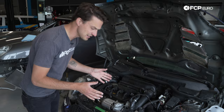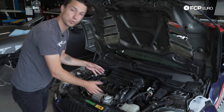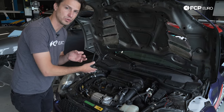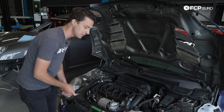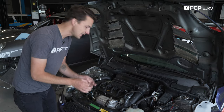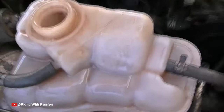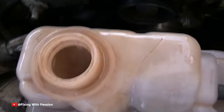As the car came back to the pits, the first line of defense was to put some coolant or water into the car to try to cool the engine down. You want to be careful about doing that because you can crack the block if you add water too quickly, but most modern cooling systems aren't going to cool water from the reservoir that quickly. One thing noted when that happened was the water seemed to be under pressure — a little bit of pulsing. That's an indicator that the combustion chamber has been connected to the coolant jacket in the engine, probably through the head gasket, meaning the cylinder pressure is pressurizing the cooling system.